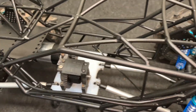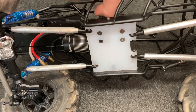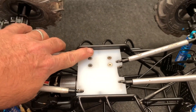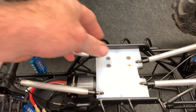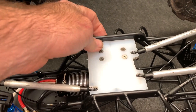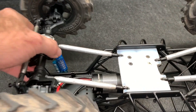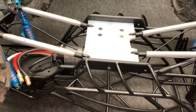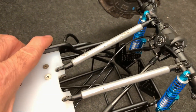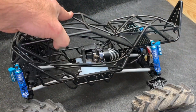There's one thing I've got to correct: I used the bolts that the Traxxas transmission is supposed to bolt to — look at all that. I've got to bring this down to at least close to even with the bottom of it, because I can get better driveline angles if I bring that down. So anyway, I've got a lot of work to do — cutting, welding, just all kinds of stuff to take care of.